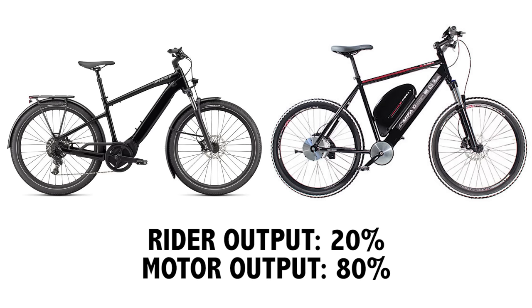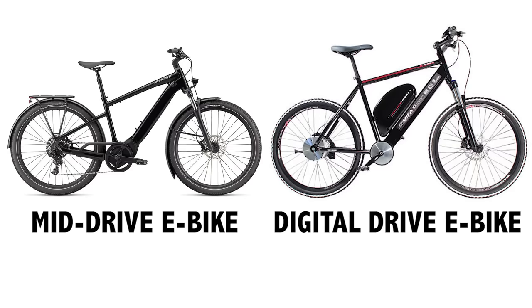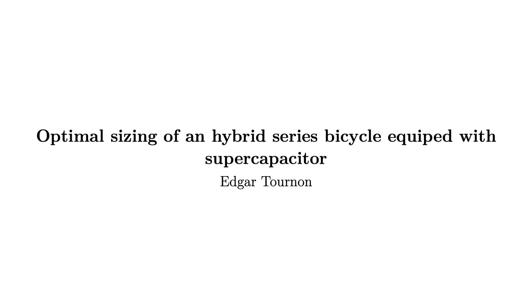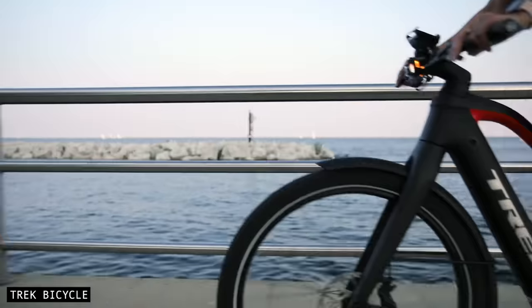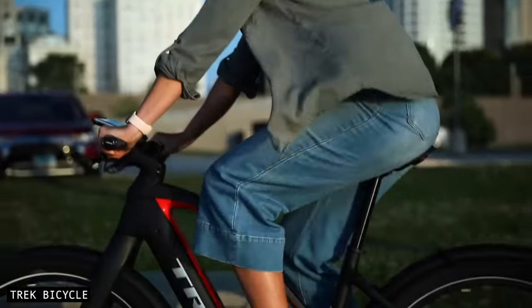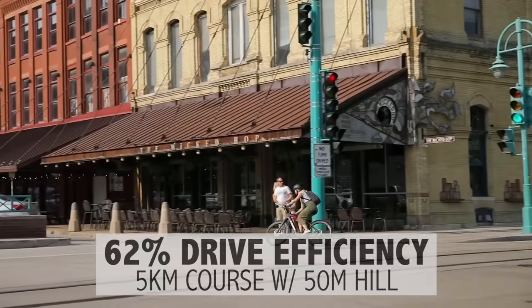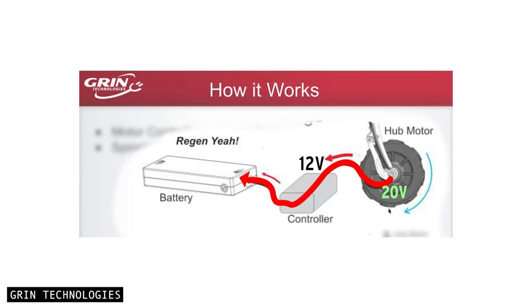When the motor is doing the majority of the work, digital drive e-bikes are closest in drive efficiency to chain drive e-bikes. For example, if we compare a mid-drive e-bike to a digital drive e-bike with 200 watts coming in from the battery at 50 watts of pedal power output, we can theoretically achieve similar drive efficiencies, because there is only a small amount of energy lost to the generator. A thesis by Edgar Tuinon, a student at Claude Bernard University, found that with his digital drive system, effective drive efficiency of close to 75% is possible on a 5km flat course, and around 62% if you add a 50m hill in the middle. The reason the efficiency is so high is that energy can be recovered by the motor when slowing for traffic lights or cycling downhill.